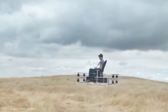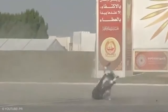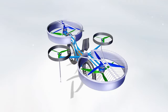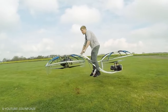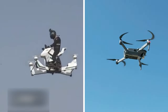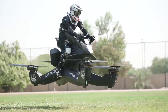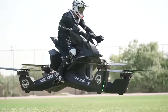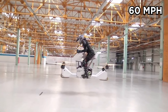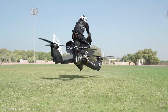We've all seen the hover-bike idea before, and the horrendous Dubai helicopter crash shows what happens when you go too far with these types of things. Still, this particular bike is a work-in-progress project which is already pretty stable. It's set up like a typical drone with auto-hover and auto GPS. The newer version will also incorporate fly-by-wire joysticks and be governed to 60 miles per hour. There definitely should be incorporated safety features like isolated flight control systems.